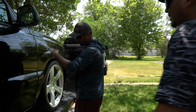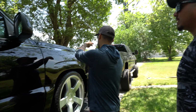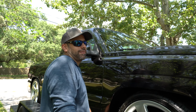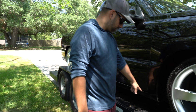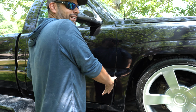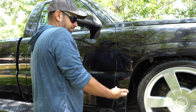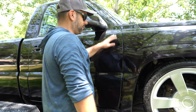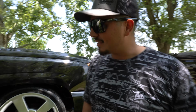The gap is closer here, and here it's more open. So the fender needs to be adjusted. The hood needs to go forward. And not only that, you remember, they molded this together. So you can't even shift it. On the front one, the one that goes on the fender? Yeah, you can't even move it. Because they molded the fender and the cap together. If they would have done the gap perfectly on both sides, there's no issue. You could fix it, but you have to take all this off, completely off, and start from scratch. Just gonna build another SS clone.